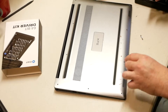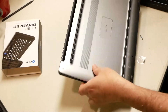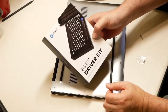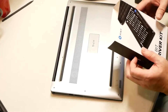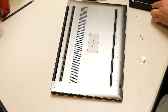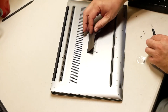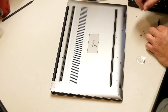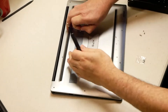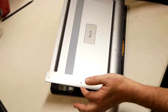So I've already kind of took a peek inside. This is obviously the top of the laptop, this is the bottom. You're going to need your trusty iFixit driver kit, if that's the driver kit you prefer, and you'll be using the T5 bit. Underneath this flap are two more longer Phillips head screws. Once you have removed all those screws, this bottom case comes right off.